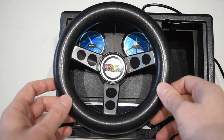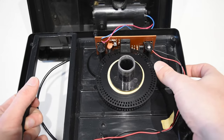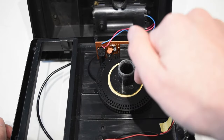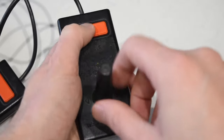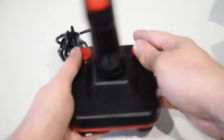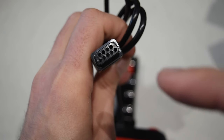In this second generation controller, the wheel turns all the way around — there's no potentiometer. Instead, there's a plate that moves through an optical sensor, which sees when a hole passes by and reads the motion based on the movement. More typically at the start of the second generation, we saw controllers borrowing from the arcade and moving towards joysticks as the main driving mechanism. These controllers also usually had just one or two buttons, as seen with the TI-99/4A controller. The disadvantage was that these joysticks used button or switch presses to determine directional movement, lacking the fine detail control you could get with the potentiometer. Both of these controllers used the 9-pin Atari joystick connector, common for most consoles of the era — used all the way into the Sega Genesis, a full two generations later.